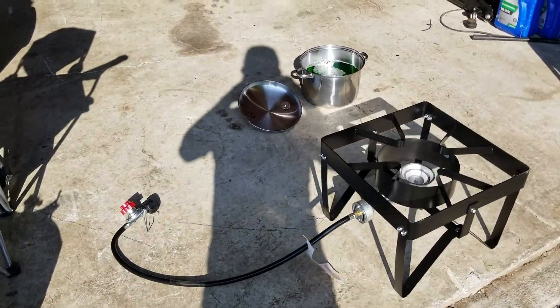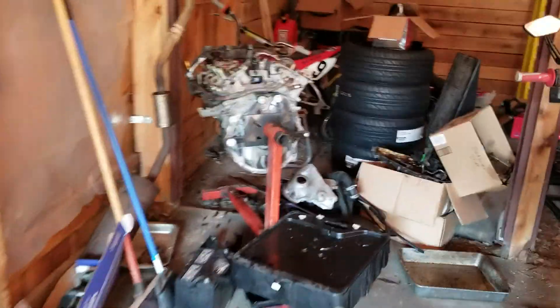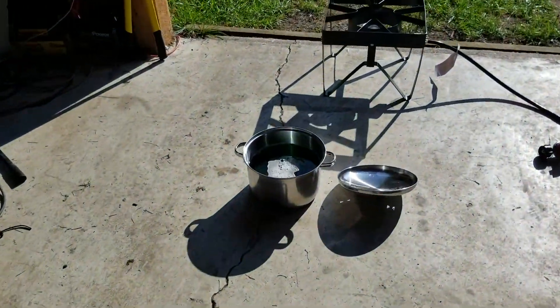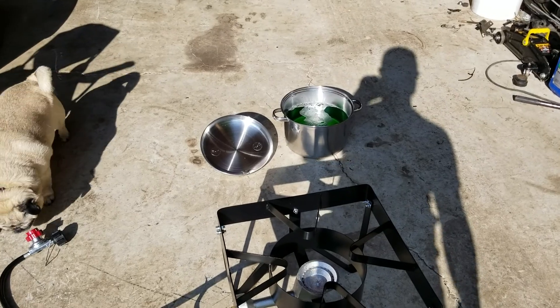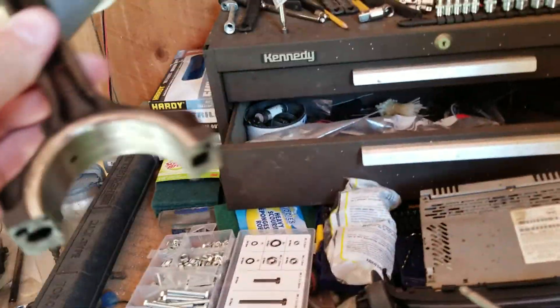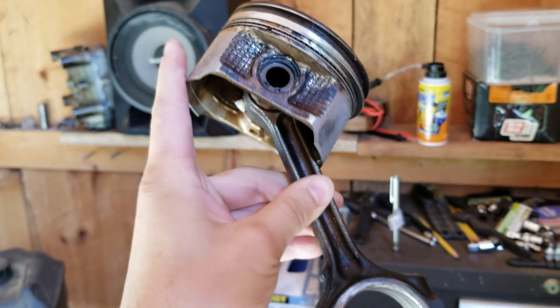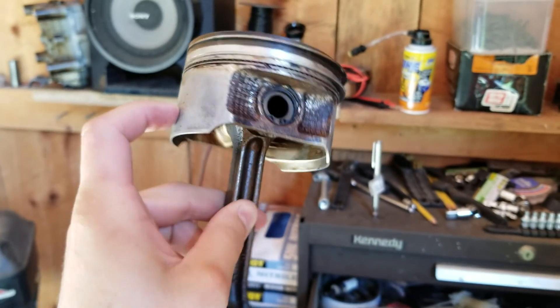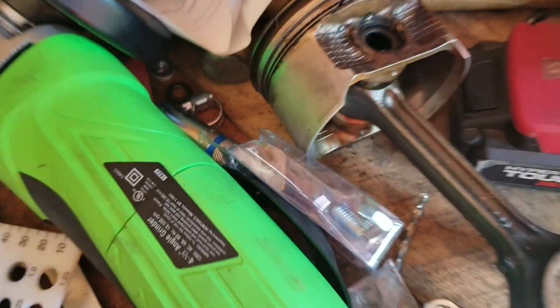I've got a big burner — can't remember the BTU but it's over a hundred thousand — actually meant to heat up 40-something gallons when I use this 55-gallon drum for a hot tank. But I'm going to experiment with this little pot so I don't waste a ton of cleaner. It's probably about two gallons of water and half a gallon of Simple Green. I'm going to tank a piston and a rod for a couple hours. Some people say Simple Green will melt the aluminum, some say they have great success with it, some say to use aircraft cleaner, some say don't bother. This is a scrap piece from my QR that I bought blown up, so the rod is steel and the piston is aluminum — I'll see how it reacts on the different materials.